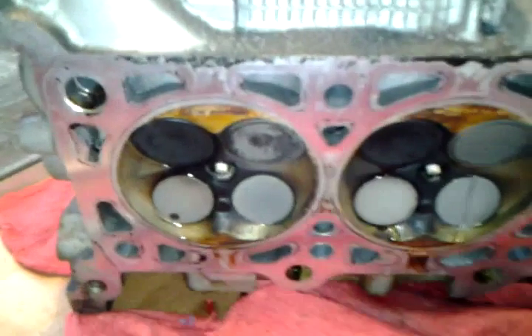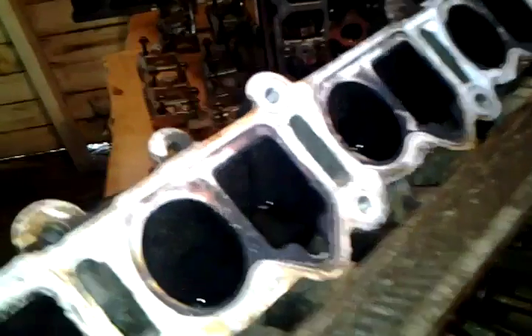These two are definitely leaking. This one's leaking a little bit. That one's definitely leaking out. So we've got bad leaks on all four cylinders. See how I poured water down the intake runners? It's supposed to have a perfect seal, so it's not supposed to leak water, but you can see it's leaking water there and there.